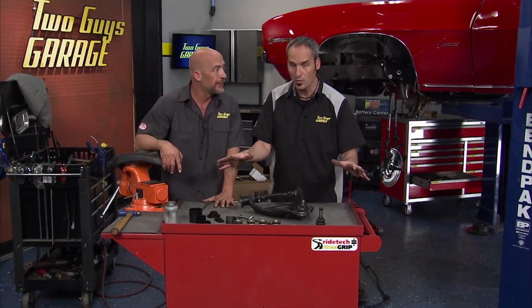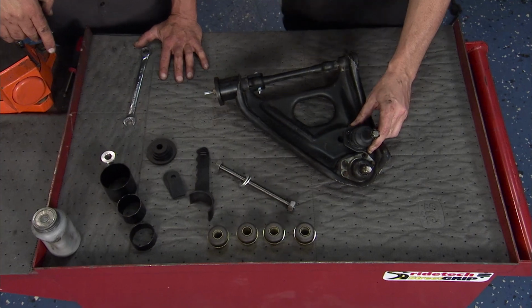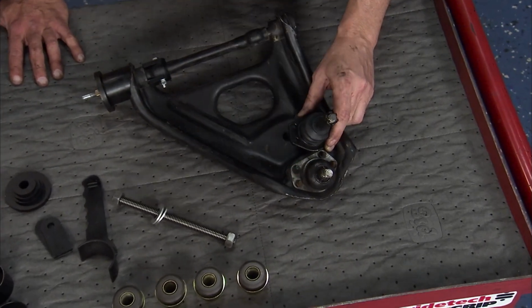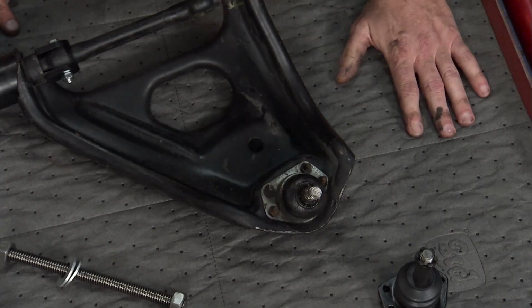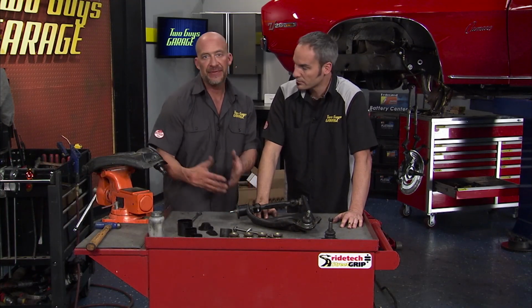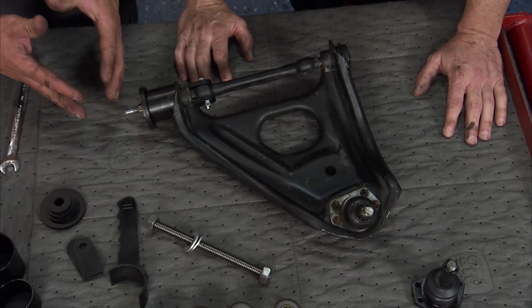Suspension all blown out, we're going to start with the upper control arm. Now you can see it's out, we've got our taller ball joint that we talked about, improved the geometry. Now in this case, it's already got a replacement bolt on. It might have sort of a rivet system. You'll have to just shave those rivets off, but this is easy, unbolt and bolt, but first, we're gonna get onto the bushings. And what a cool little tool. Sometimes if you have a press, maybe you can get in there, but it's tough to get the angle right, especially when you're pressing these guys back in.